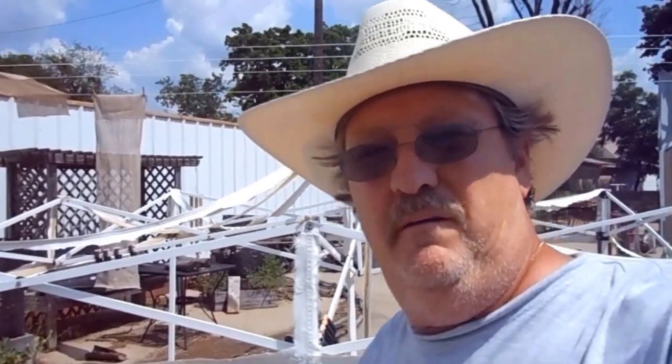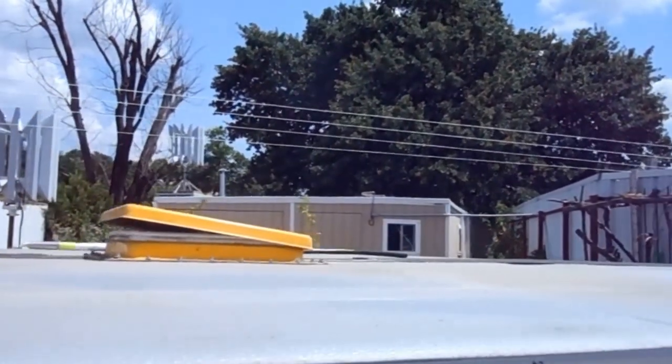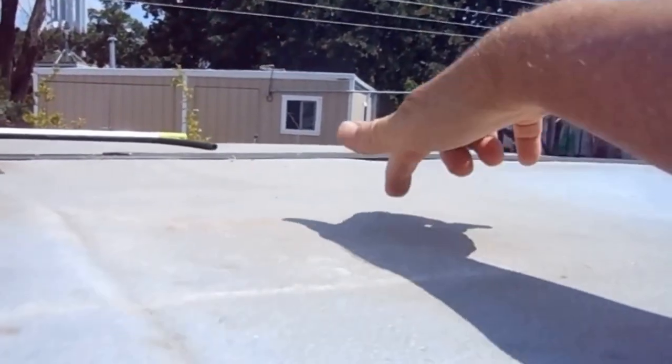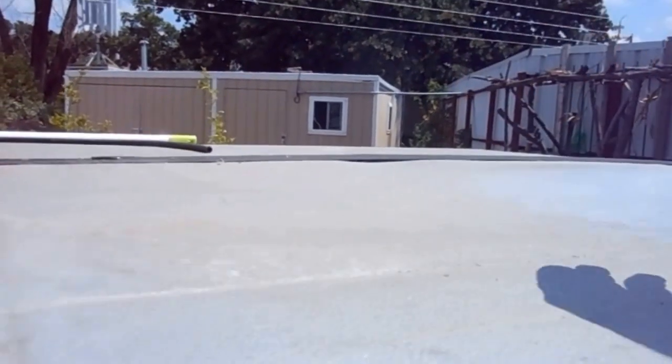Right now I've got a few patches to make on this canopy, and I need to show you why. I have to have a canopy that sits over the top of my camper. The skin of the camper can move up and down — it's actually released from the styrofoam roof. The skin is about as thick as an aluminum can. Underneath that is a half-inch thick styrofoam, and underneath that is a 1/16th-inch thick plywood. And that's the roof.